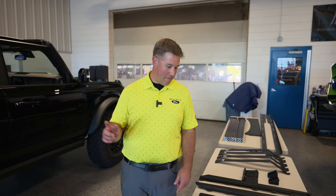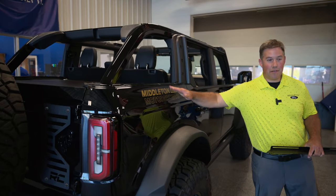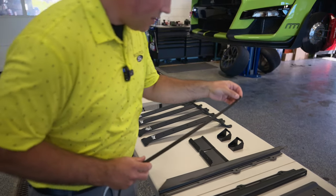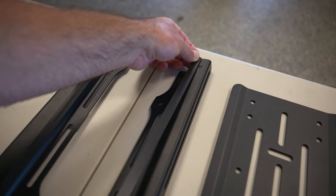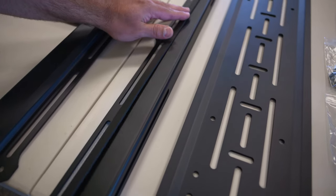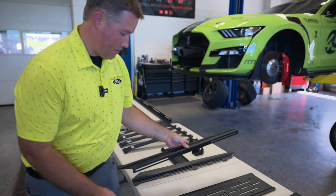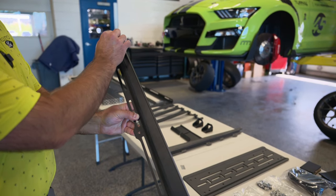We already removed the roof rack because that's the next step. We've got to start mounting these brackets which go under the roof right here. First thing I do is put the foam on this so it doesn't damage the paint — long, skinny foam here. We found it's going to work best if you put the foam so it just wraps around this edge here, so we're just going to put it right over the end and it wraps around there. This protects the paint the best from the test fitting that we did.